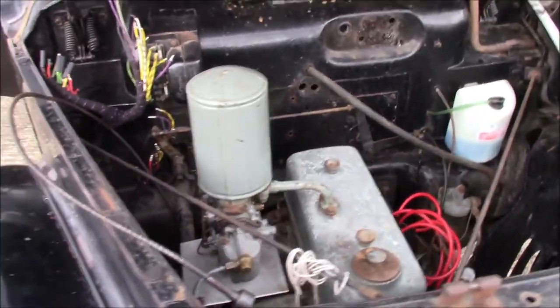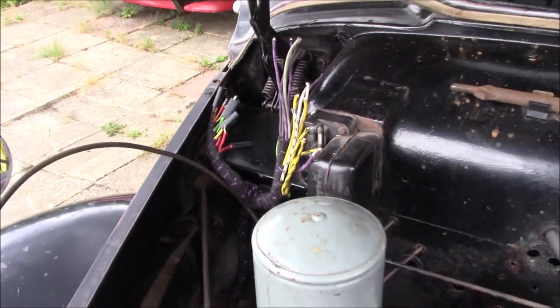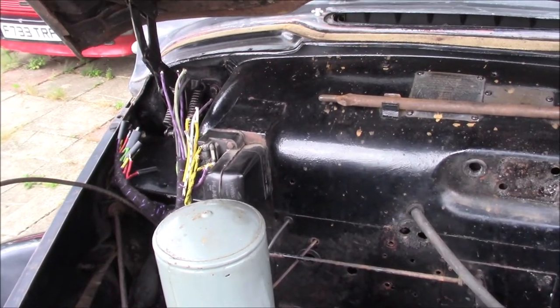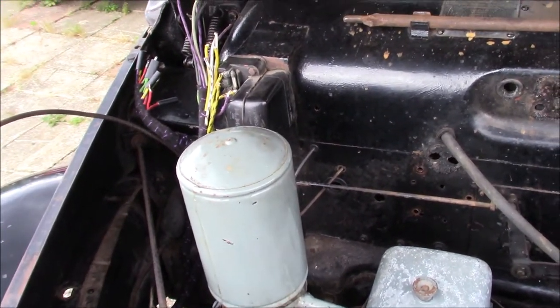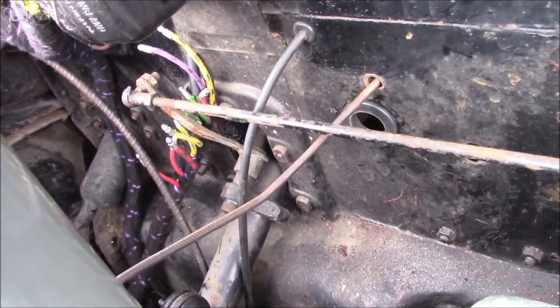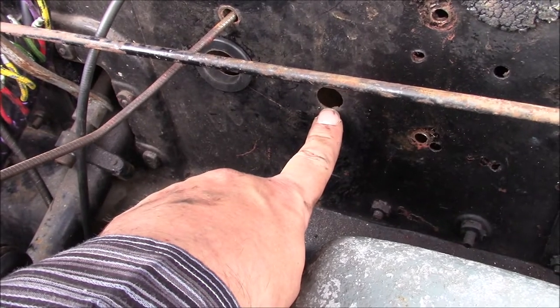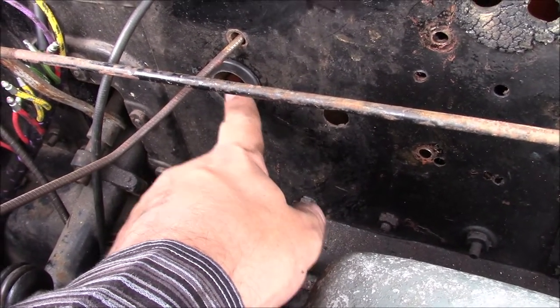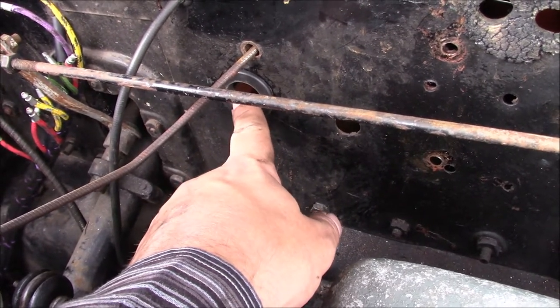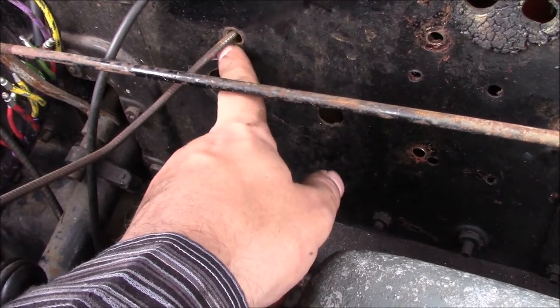That's what's slowing me down on this job more than anything - all the bits and pieces, it's all trial and error. There's a little bit of guidance but what there is is generally more confusing than helpful, not because the information out there is particularly wrong but because these cars are so old now that everybody has done theirs a slightly different way. There aren't many original examples left. I'm going to pop that grommet out because with that in, this doesn't fit - that's how tight the fit is. And I think this one is for the temperature sender. Before, the temperature sender and the speedo cable both came out of this one, but on other cars I've looked at some do and some don't. Put a grommet on here - this is the choke cable one - just to protect everything; it's clearly not had one for a while.